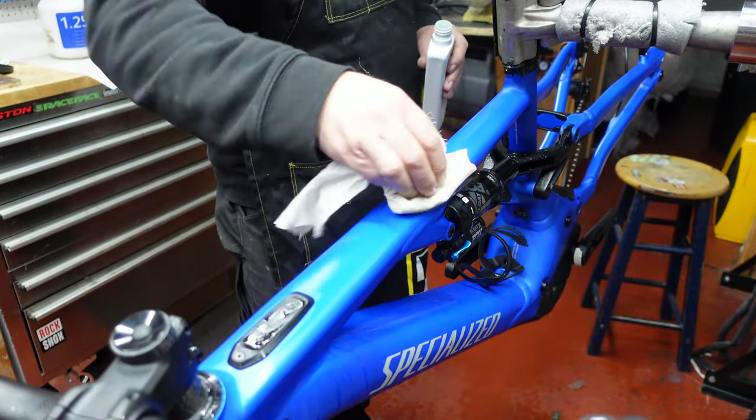This is a big piece, so we need to be careful how we do it. We do small sections at a time, scraping the water off to the sides with a squeegee till it runs off the sides of the frame and down where it's loose, okay? And we just work our way down until all that water out of that bottom piece has gone. And you can see that there's no bubbles in there now, or there won't be when I've finished. Squeegeeing those little bubbles out, these bits of water underneath.